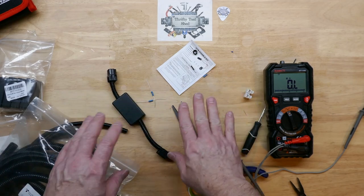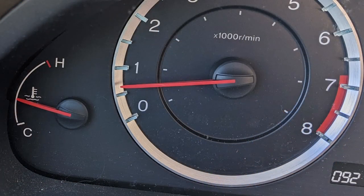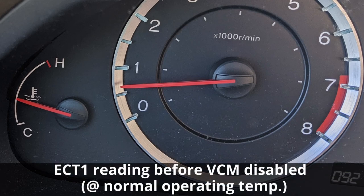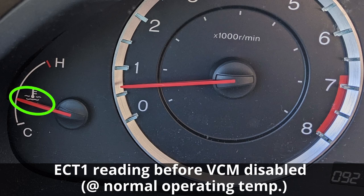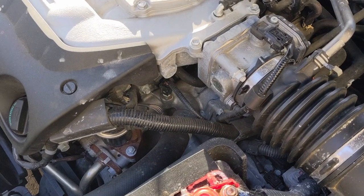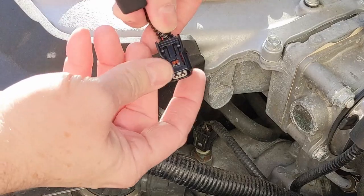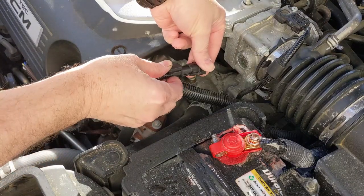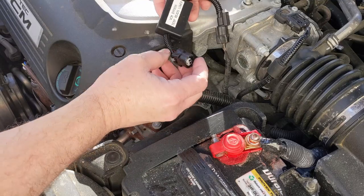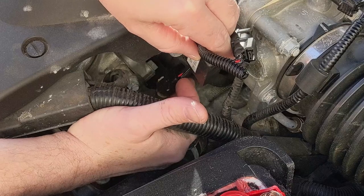We got these other resistors we can test with as well, and I have many resistors also in between if need be — but apparently these are the ones the manufacturer thinks are most commonly used. Before we put this on, let's do a test and see what the gauge is at normal operating temperature. This is my ECT1 reading on the gauge before we disable it — the needle is almost touching or right at the bottom white line on the gauge. Here is our ECT1 connector and the sensor right here. I believe we can get to it fine without removing the engine cover. We have a mating connector and here is our little lever — push it and wiggle up and it pops right off. We just put this in line: back on the wire that came off. I label mine so I'm not the only one who knows what this box is.